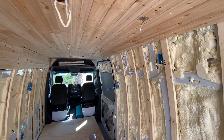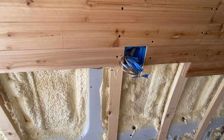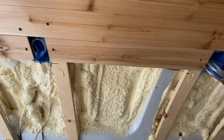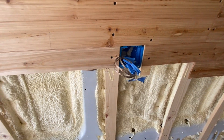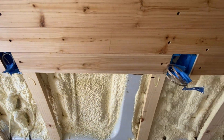I'm also using some of this extra insulation to tuck into the low spots just to maximize the insulation and keep it nice and cool in here. I also like to put a little bit of wood glue on each beam before I put the next plank in — that should help with the creaking you hear on most vans when you're driving. It's wood on wood rubbing, and the wood glue pretty much eliminates that.